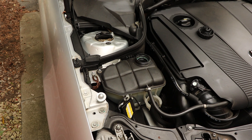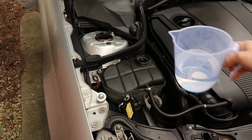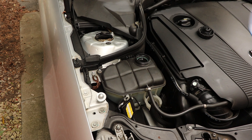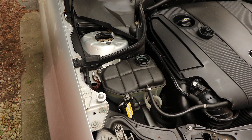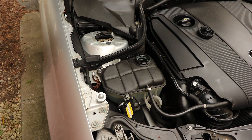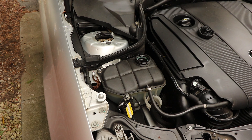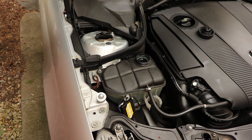To open the cap, make sure your engine is cold or very mildly warm, and if it's mildly warm be really careful. Open it very slowly with a towel on your hand — the coolant can be much hotter than normal water and can cause chemical burns and seriously mess you up. My engine's cold so I'll take it off. If you're filling a more substantial amount, follow the mixing ratio on the coolant and get the correct coolant for your car. I'm just topping up with a bit of water as my level is pretty much okay.